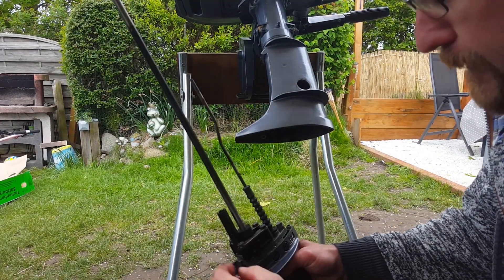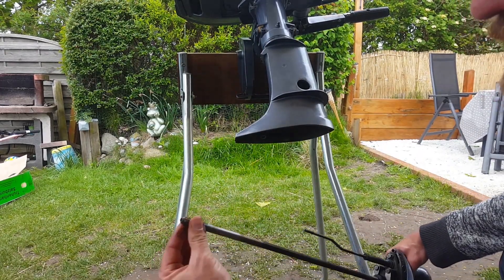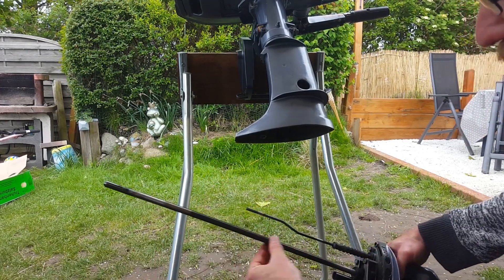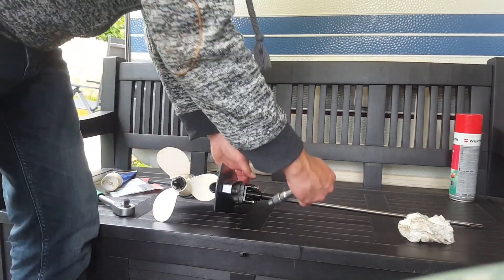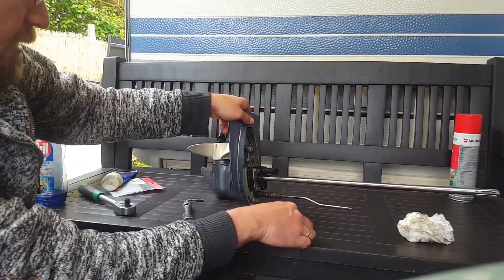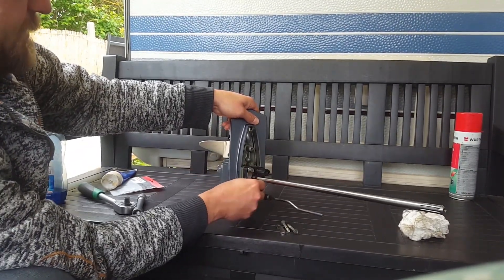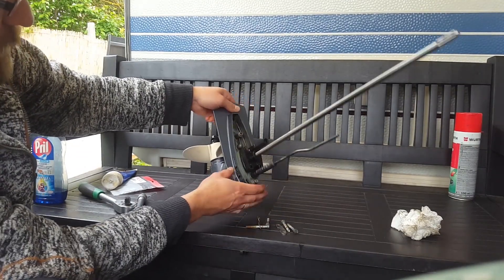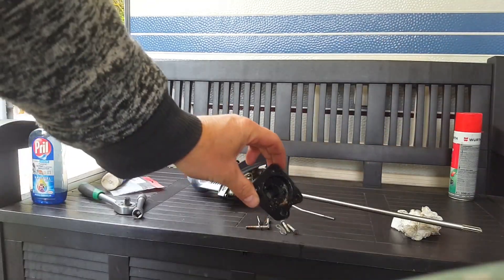This is the one where the water comes up into the engine — this is the drive shaft — and after reinstall the drive shaft just give it a little bit of marine grease. I will clean this with soap. The next step is to remove these four bolts, 10 millimeter. There's a top plate with some dirt in it.